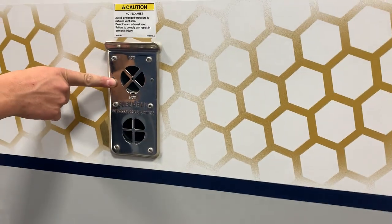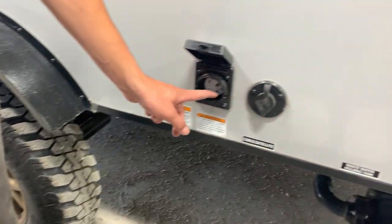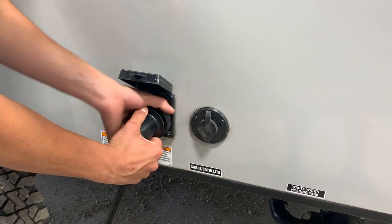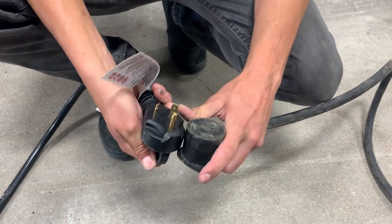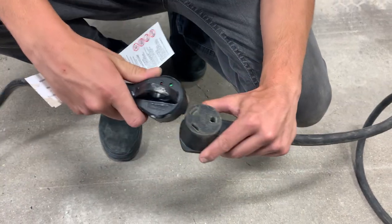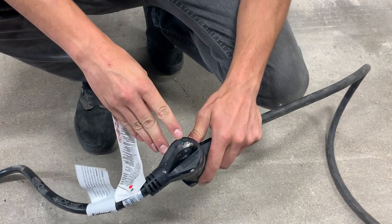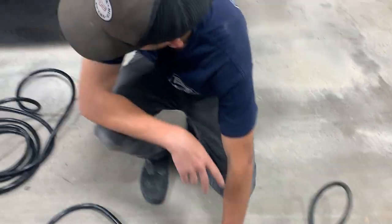Whenever your furnace is running, this vent will be putting out hot air, so be mindful of that. Then you've got your twist-lock 30-amp connection. Take note of that notch — it lines up with the notch in the bottom corner. Push it in and give it an eighth turn to lock it down, then use the threaded collar to really secure it. Following that cord back, you come to your standard 30-amp plug end, which most campsites should have. If you're at home or your campsite only has 15-amp service, we do include a 15-amp park adapter. Keep in mind that on 15 amps you can really only run your fridge and lights — you can't run your air conditioner. When you plug in, there are two indicator lights at the top: a green light means you have a good power source, and a red light means you have a bad power source — that's the first place I'd look.